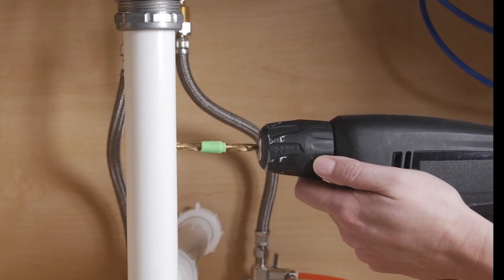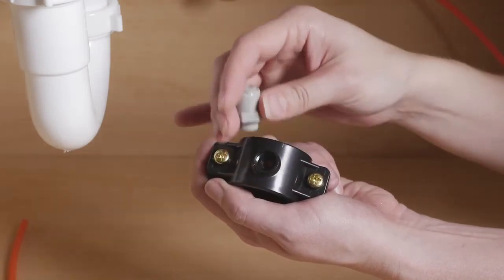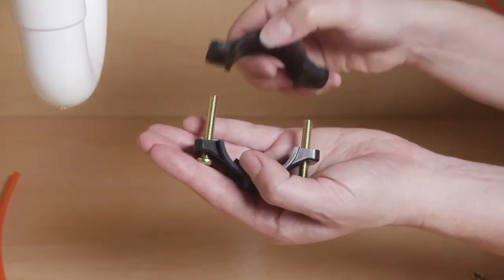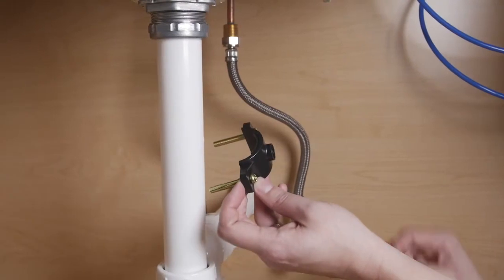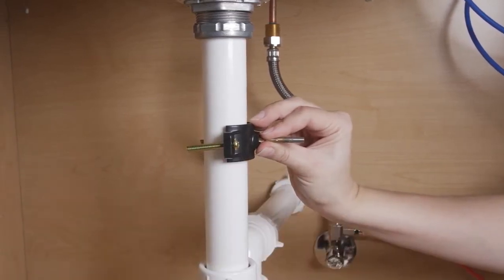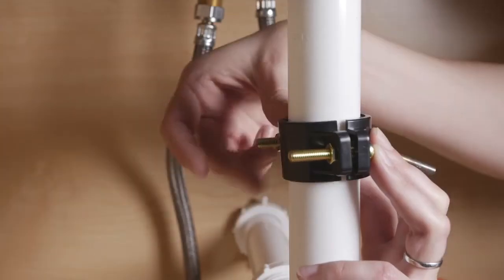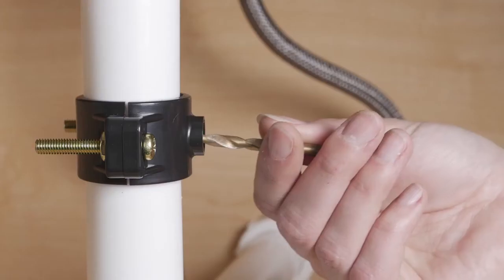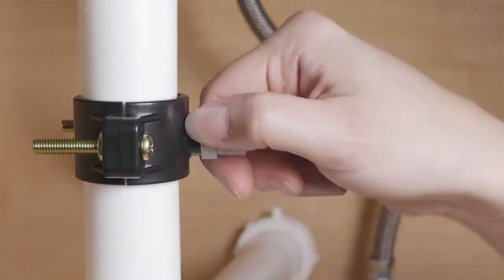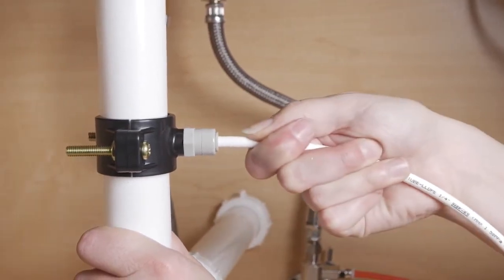Use a quarter-inch drill bit to enlarge the hole. Next, unscrew the gray quick connector from the saddle of the drain clamp and disconnect the two clamp halves. Insert a straight thin item into the front of the saddle and then insert the end of the guide into the hole drilled in the drain pipe. With the clamp lined up with the hole, screw on the back of the clamp and tighten with a screwdriver. Remove the guide and reattach the quick connector. Next, insert the white drain tube into the quick connector and push firmly into place.